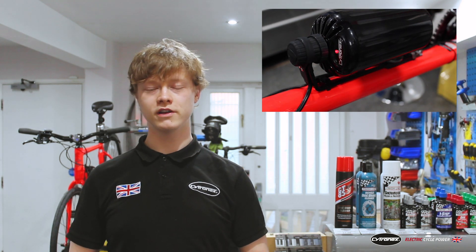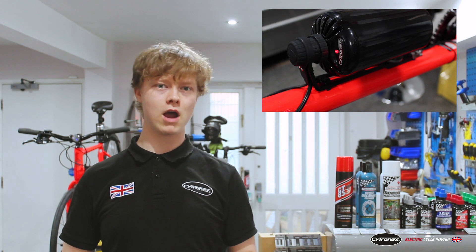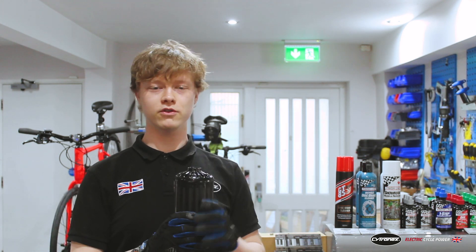The charge level of your C1 bottle can be seen through the LED on the top of the bottle. There are four colours, each representing a quartile of charge. If it shows green that's 100% to 75%, then it will drop to blue, then purple, and then red is your last quarter of charge. This will actually turn into a pulsing red once it hits the last 10% and you'll feel the power ramp down. You can check your charge level quite easily by doing a quick inversion, and then the LED on top will show for about five seconds showing you your charge level.